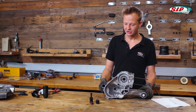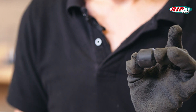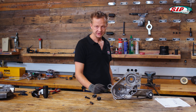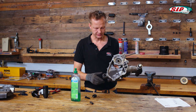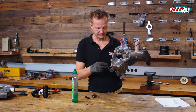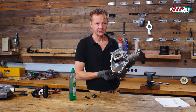Let's finish the insertion of the bearings and bushings by assembling the last bushing on the rear of the engine. For this I have the rubber piece and I'm going to use the flywheel puller to press it in. A good aid for this process is some soap from the kitchen, and you can also use the bench vise. I don't use oil such as WD-40 because the oil will remain in the bushing and keep it slipping, whilst the soap will disappear because of humidity from rain and so forth.